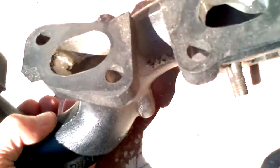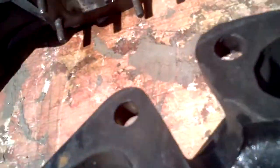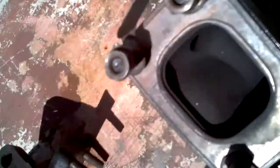I've mostly cleared out these humps that are in here. I don't know if you guys can actually see that yet - I think you can. There's one big one in the left corner there, this one's gonna be a bunch to clear out. This side's a little more significant because of the EGR tube and the way it is - the chamber is just smaller.